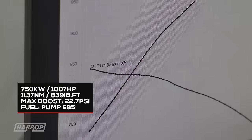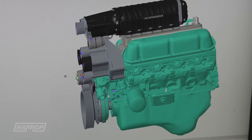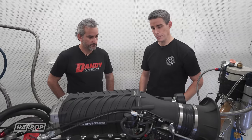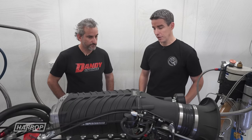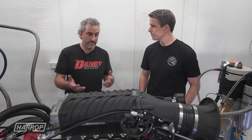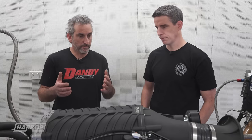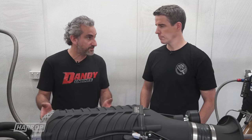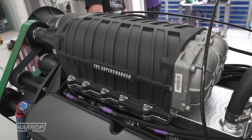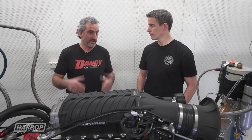The larger crank pulley is the limiting factor on this combination, but you can run a smaller top pulley to get more blower speed — 22 pounds and 1,000 horsepower on E85 is a killer combo. And we haven't even touched on running a better cylinder head, more compression, more camshaft, or ice water through the intercooler. If you're going to the track and want more horsepower, it's there.